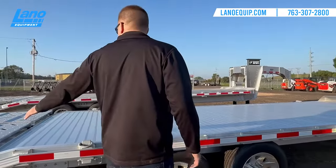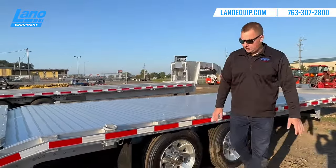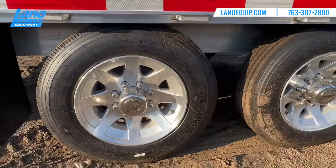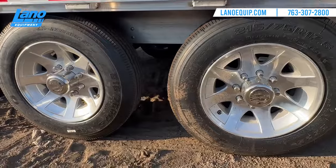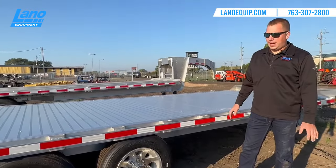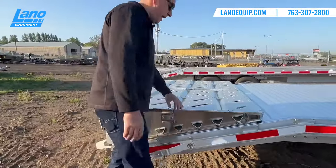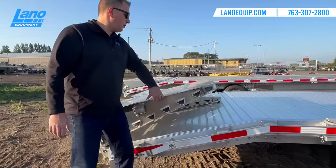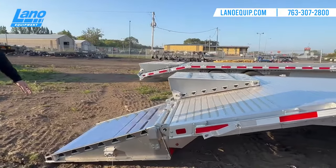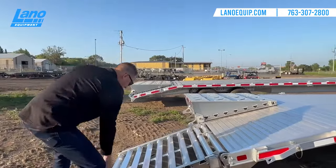This is the EV16, a 20-foot-long trailer with a four-foot-six beaver tail and 50/50 ramps. It has two 8,000-pound axles running 215/75 R17.5 tires on aluminum rims — heavier-ply axles for hauling heavier skid steers and excavators. All tradesman packages we bring in have the 50/50 ramps, making it a one-man operation to get the ramp down and back up.